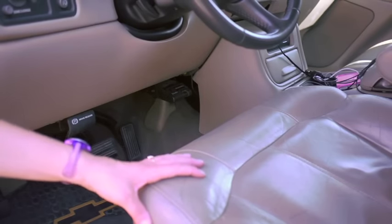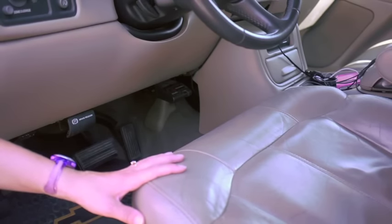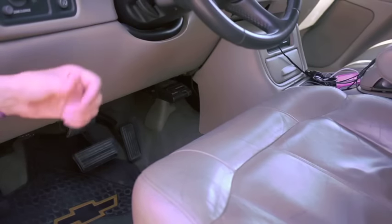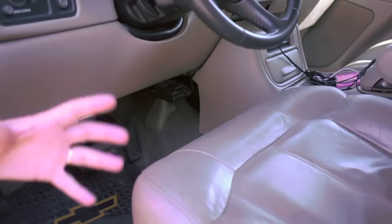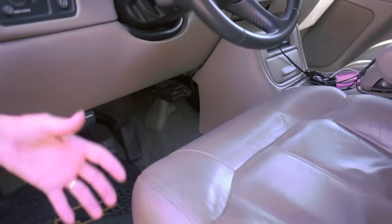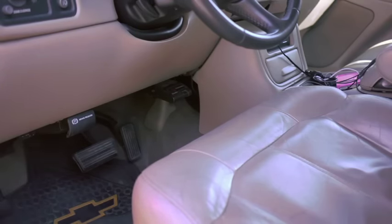What I'm going to have you do before you leave is use my gravel lot — that's part of the reason I keep gravel — so you can play with those electronic trailer brakes. Turn the gain control all the way up, get going, and press on those brakes. I want you to feel the pressure of having the trailer do all the stopping for you. You will feel that trailer stop and jerk you back. The trailer's brakes are not anti-lock brakes; they will just lock up and drag, so it's very uncomfortable if they're not set properly. Make sure you're in a comfortable position with your electronic trailer brakes.